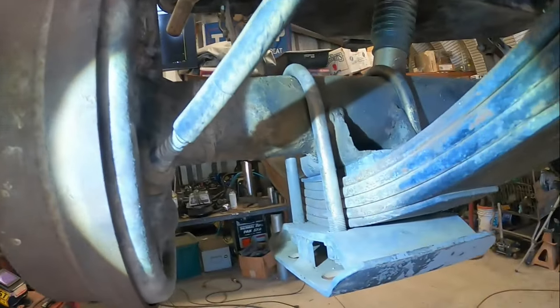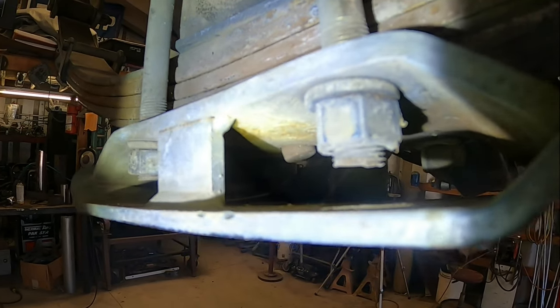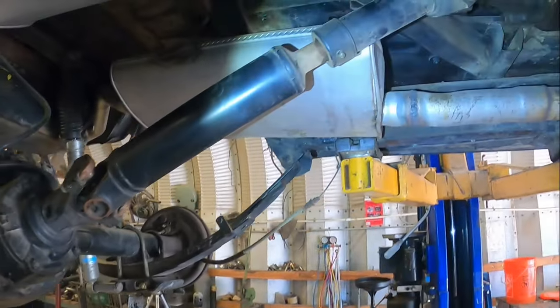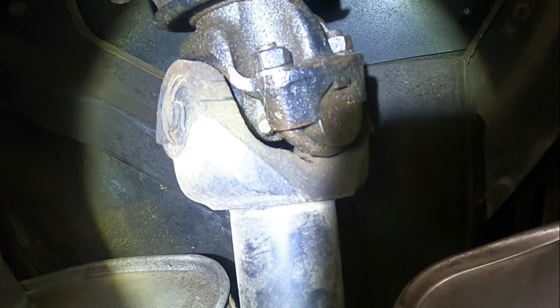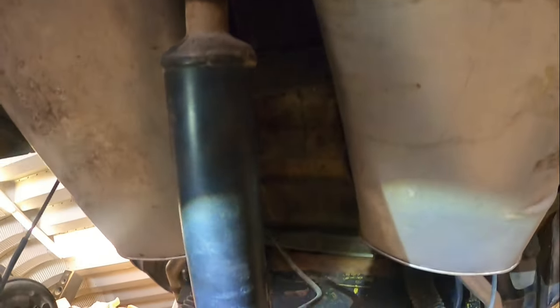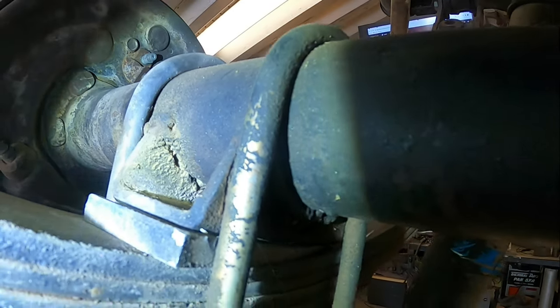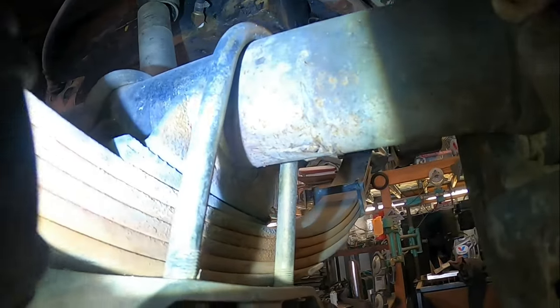Just to give you guys an idea of what's going on here - I'm pretty sure these pins, like you can see that one right there, are nowhere near perfectly straight. So I'm pretty sure that one sheared and went forward. Nothing's really correct dimension. Another thing we gotta look at is the U-joints right here are binding - it just binds right there, no one clearanced this. So I'm going to pull the drive shaft out, clearance all that, and probably just drop the whole rear end because all this needs to be redone. It's definitely not safe and hasn't met my safety criteria here. Anyway, we're going to get to dropping the rear end.